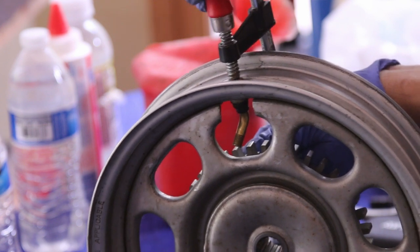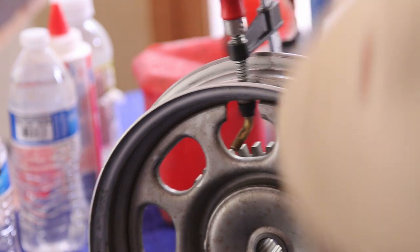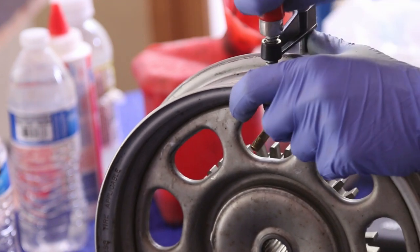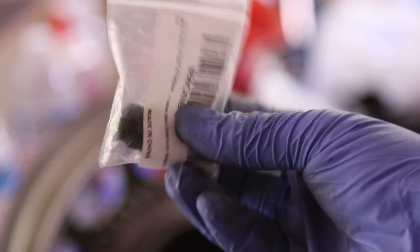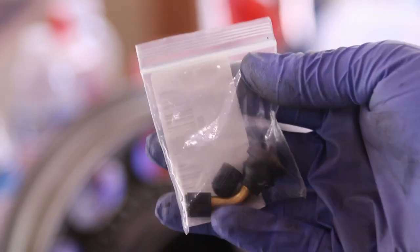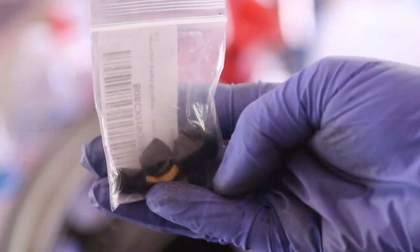I'm going to put more pressure on one side than the other. The right clamp is what we needed — the little clamp initially did not give enough pressure. So this is where the valve stem goes; it comes with two stems and little caps for five dollars, very inexpensive. A lot of times if your tire is leaking, check the stem as well — sometimes it leaks around the rubber. I had to replace this on my Yamaha C3 scooter, which is why I had an extra one laying around.